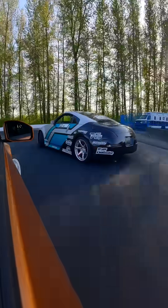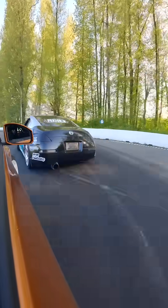Then I went to an open drift the next weekend and every like five laps, it just kept blowing the fuel pump fuse. This car is LS swapped. It has an AEM 340 liter per hour fuel pump in it, and the previous owner who did all of this swap work was just running it off of the stock wiring — like 18 gauge power and ground wire.